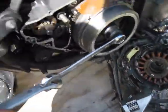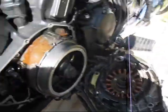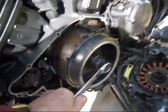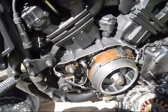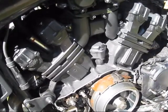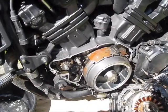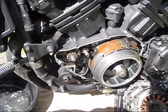It looks like the motor was frozen up, but I used a couple of double wrenches here and was able to break it loose. So it's turning over. I was afraid there for a minute — they said it did run. I'm just going to pull the spark plugs and squirt a little WD-40 down in the cylinders.